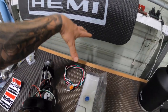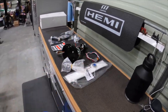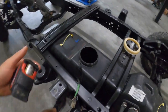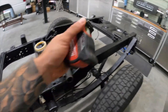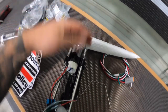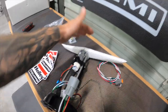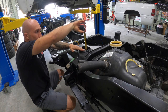The wiring we're going to handle afterwards once we get our Holley EFI all set up, then we can wire everything up. So let me go ahead and put this sock on. We've got the sock on, we've got our float on. What we're going to do now is take our tape measure — you want to take something relative so from the bottom of your tank, I like to go to the edge of the lip where the pump is going to sit. You want to make sure — because you can adjust this pump — that the sock is on the bottom of the tank, so that if you run low on fuel you're actually able to pick up from the bottom. We measured it at about 13 and three-quarter inches to the lip.